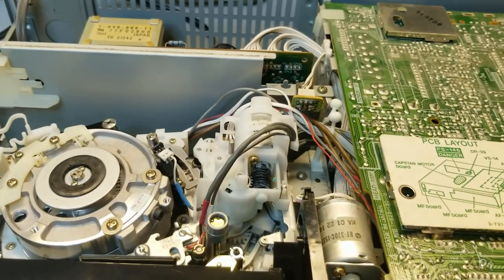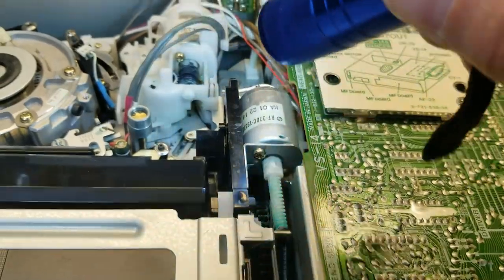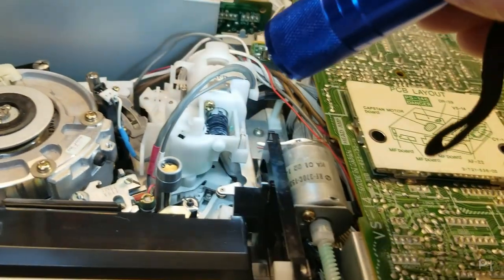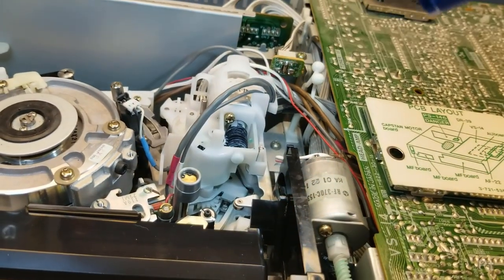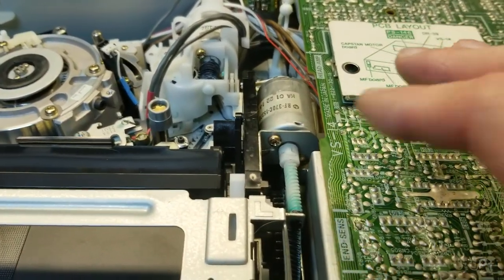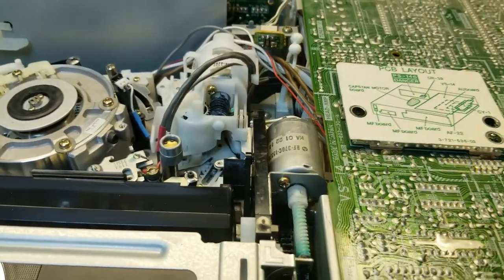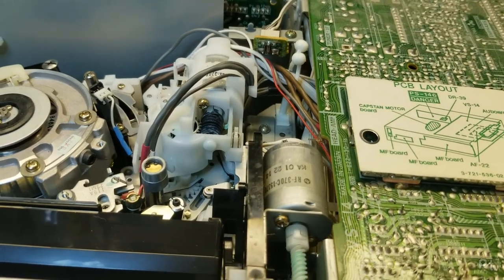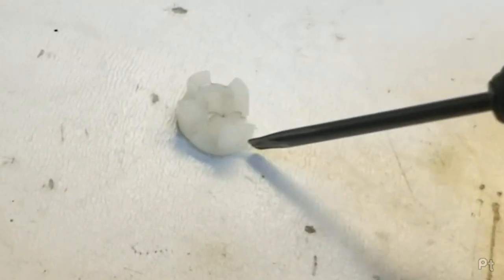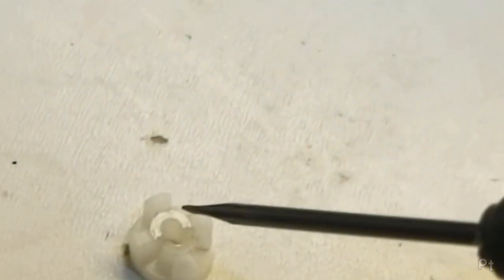I wonder if you can buy replacements for those. I've seen that in so many Sonys — like this one here. That crack. I've seen so many Sonys with these just break. And like, how do you fix it? I tried to fix it on my 860Ds, and it worked well enough, but it would still slip. I mean, metal is slippery — even if you try and rough it up and try JB Weld, it's gotta be a friction fit. See, it's all cracked and busted — this one's busted in two places. So this is slipping when it tries to load.